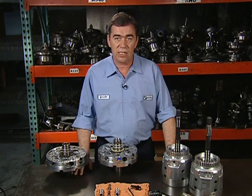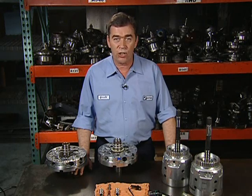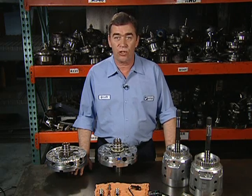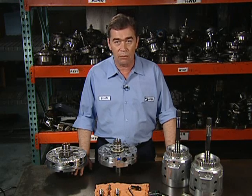The ISS assembly, as shown in Figure 2, is a 3-wire hall-effect sensor and is internal to the transmission. ISS operations should be thoroughly evaluated with a scan tool prior to transmission removal for internal repairs. Due to the ISS circuitry design with its internal integrated circuit chip, it is not beneficial to measure internal resistance and therefore no resistance values have been made available.